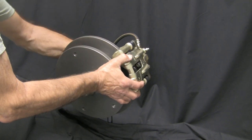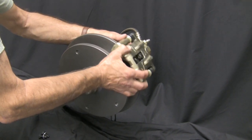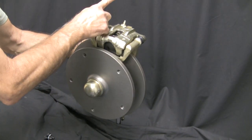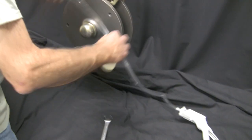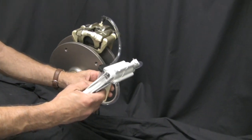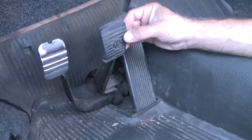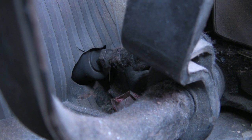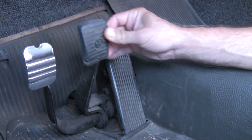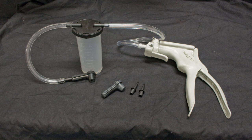Unlike the simple drum brake cylinder, the disc brake caliper design can allow for air to be trapped. So to help all the air be evacuated, unbolt your caliper and rotate it up to about the 11 or 12 o'clock position. If your brake line is long enough, just keep it centered on the rotor; if not, you will need a block of wood the approximate thickness of a rotor to be put between the pads. Never apply fluid pressure to a caliper without limiting the pad movement, or you will blow the piston out of the caliper. Bleed all four corners, then check to see that you have a firm pedal that actuates the brakes at the top of its motion. If the pedal goes down part way before brakes function, or if you have to pump the pedal to get it firm, go back and repeat the bleeding procedure — you still have air in the lines. Be prepared to repeat the bleeding procedure probably a few times to get all the air out.